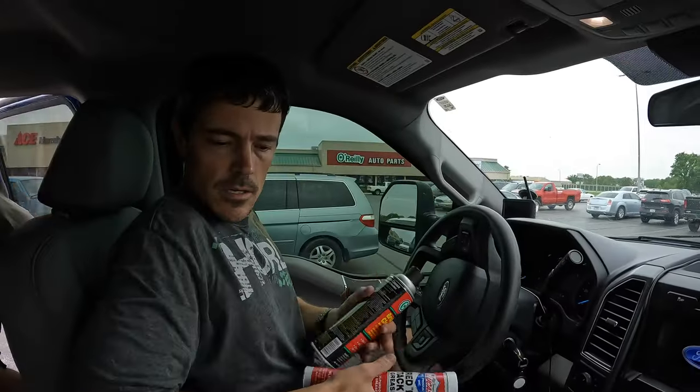Mission is not complete — managed to get our grease and brake cleaner but they did not have the seals. I found an RV dealer near me; the part number is 442-109 and they only have two. We popped into Countrywide Campers in Paxton, Illinois, about 20 minutes from camp and they had my grease seals in stock. A lot of dealers were charging three to four hundred dollars for labor alone plus parts — these new seals cost me $8.38, and I spent about $45 at O'Reilly's on grease and brake cleaner. All told we're into this job for about 60 bucks, so it always pays to do it yourself.